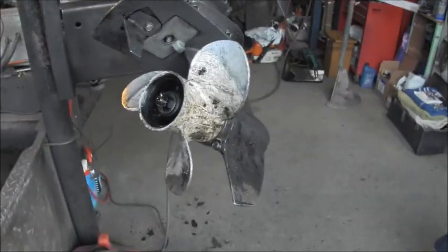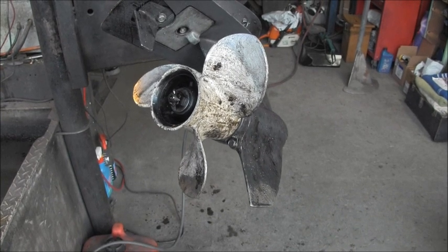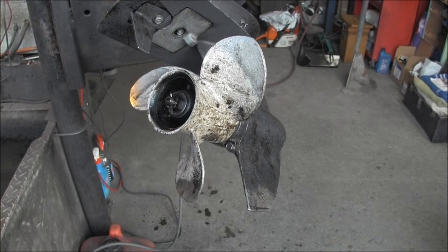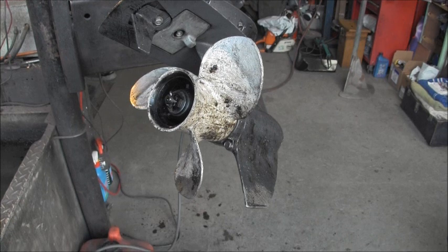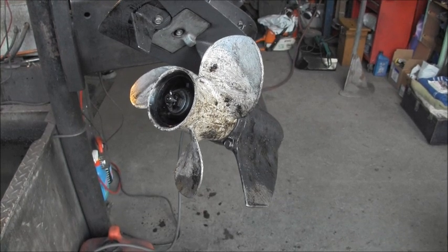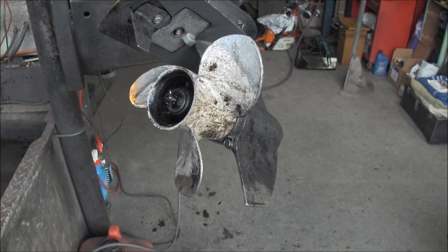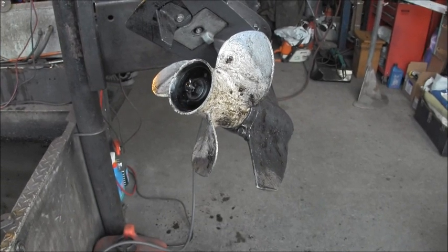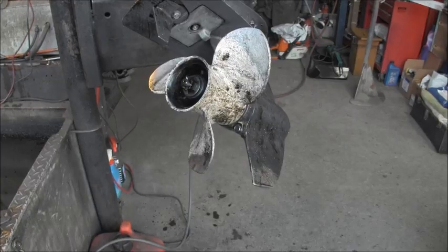That's why I can't stand when these guys, this is a 2011, still haven't figured out that this is not their grandpa's Evinrude or Johnson. This is a small car motor. This is a four-cycle engine. You wouldn't lay your car on its side. Man, what a mess. I hate to rant, but I just see so much of it, and it's so preventable.